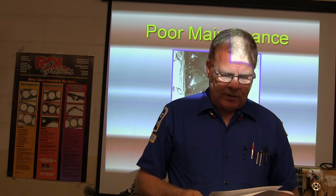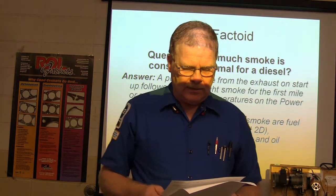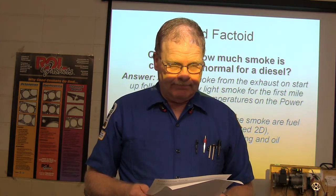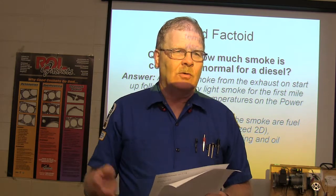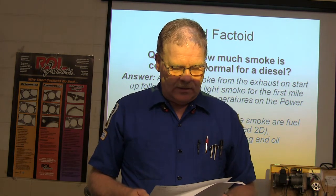Technician A says the pitman arm is connected to the steering gear. Technician B says the idler arm is used with all rack and pinion steering linkages. Who's right about that? I'd say technician A, because you don't have an idler arm with a rack and pinion. No point in that at all.